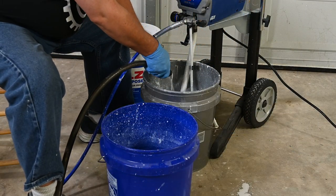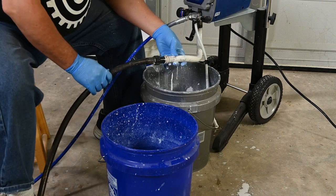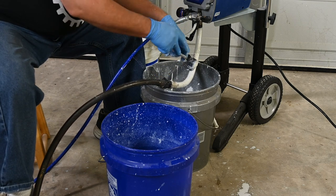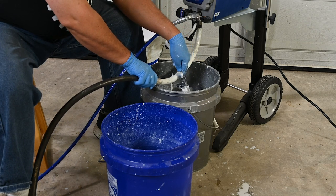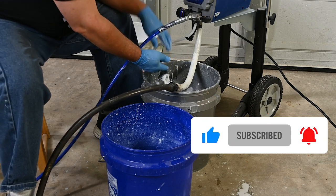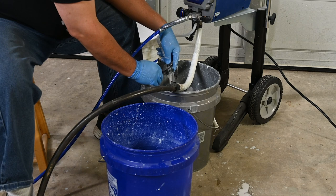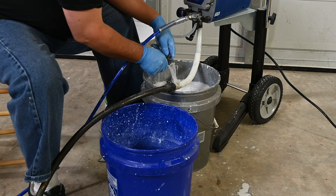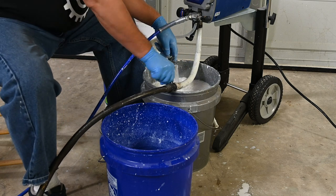Let's use the hose to clean these off good. I've attached the suction hose to the garden hose, and what I'm going to do is open up the valve and use the water pressure from the hose to push water through the pump to flush it out, and also to flush out the drain tube. We do this for about 30 seconds or so, or until the water is coming out clear. You can stick some in your hand — you can see it's still a very milky white color. Okay, that looks pretty good. This still looks a little white, but that's mainly because there are a lot of bubbles in the water. Yeah, that's actually clear, so that's good. Turn the water off.